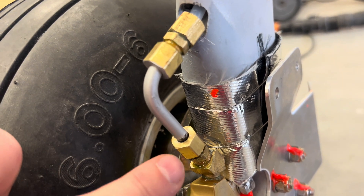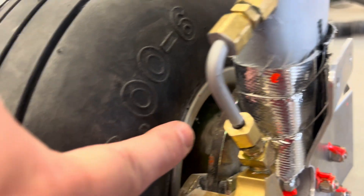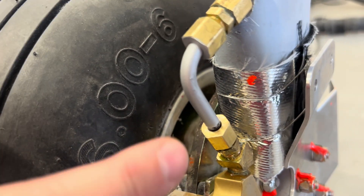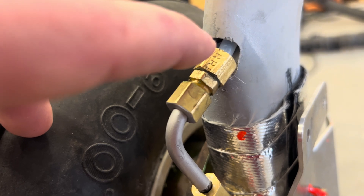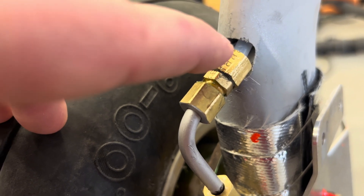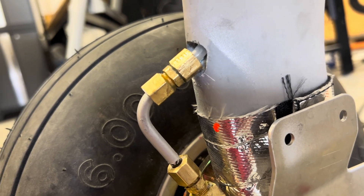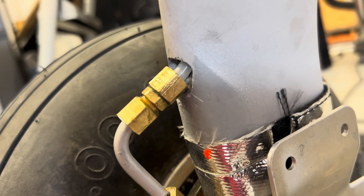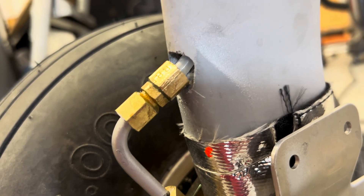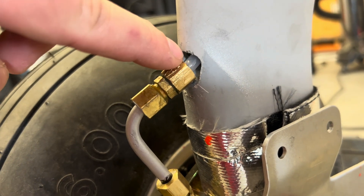The heat that travels up to here and then the heat coming off the brake rotor just has some distance to dissipate before it gets to that nylon — or whatever material it is — brake line. So I tried to leave the nylon brake line as far up into the gear leg as I could to protect it from the heat.